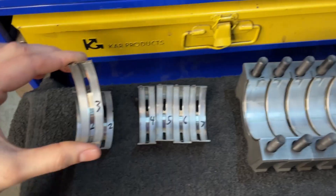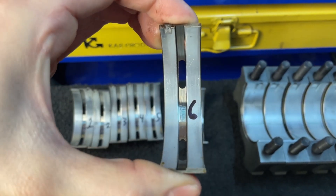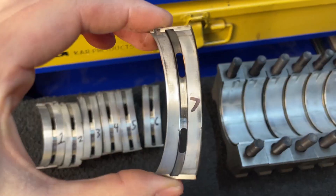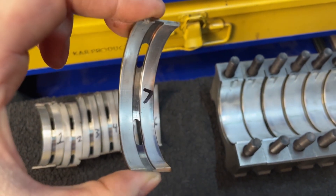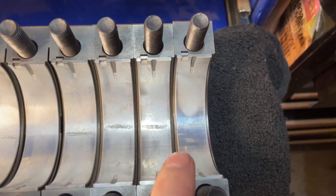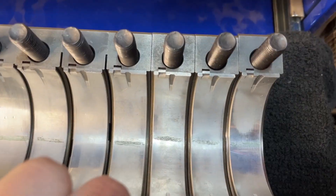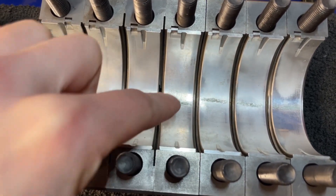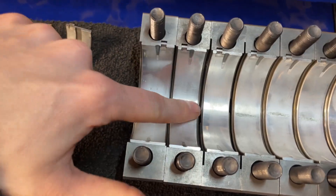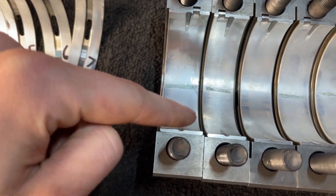You can see this one's shiny there — it's got some scuffs in it, shiny on the edges but not in the center. Same here. This one actually looks pretty good — that's kind of what I was hoping they would look like all the way around. A little bit of wear on the right side under that six, but still pretty good. And then this one is completely worn on the far side over here. It's almost reflective, and then it's got a big gouge in it right there. Coming over to the ones on the caps, you can see right here in the center of this one it's very, very shiny, and then it's a uniform satin color. A couple are not too bad, but this one is completely shiny in the center, and then this one is very shiny and blends into a more satin color.